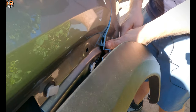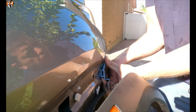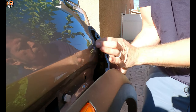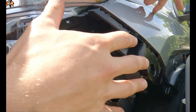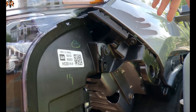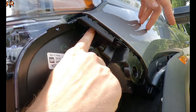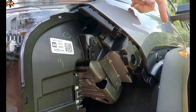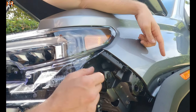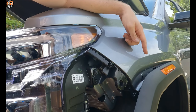Now we're going to lift and separate these two trims. If you pull on it a little bit, it'll start unclipping everything around the headlights. Now that we have the side piece taken off, I want to show you what three bolts we loosened in order to get that piece from under the clips. We have one bolt here, one bolt here, one bolt here — these are seven millimeter bolts and you get in through the fender well. You don't have to remove them completely, just loosen them a little bit so that way it pulls out and then you can unclip the sides.